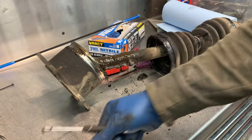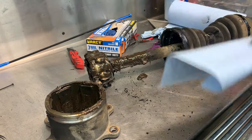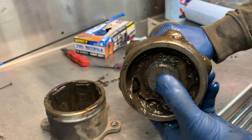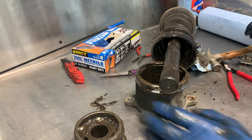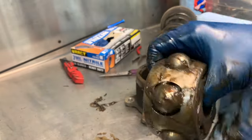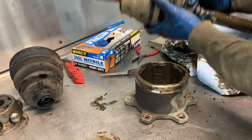There's that little snap ring. Got that cup separated. Same thing as before — there's another little snap ring in here, go ahead and pull that off then you should be able to pull this off the shaft. There's the cup removed — once again this side with the lip is facing outward, this side is facing towards the shaft. Now I'm going to put that aside, clean a little bit of the grease off, slide this boot off — this is the old boot — then work on getting the other boot off as well.